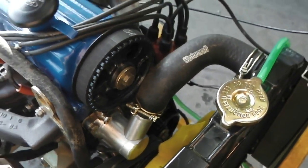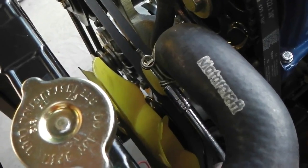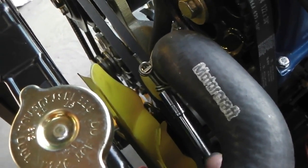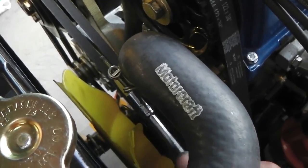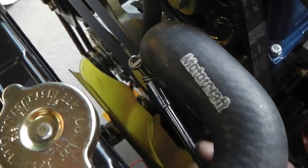It's no good there at the front of the radiator. It was obviously fitted before the rad went on. So I don't even think I've tightened that up. Guys, this is actually on upside down, but I'll leave it for now. It wasn't even tight, by the way. If you have it inboard there, so this bolt's at the top, you're going to hit the cam cover. So we'll twist it round this way and bring it in. That's better. So nip that up.